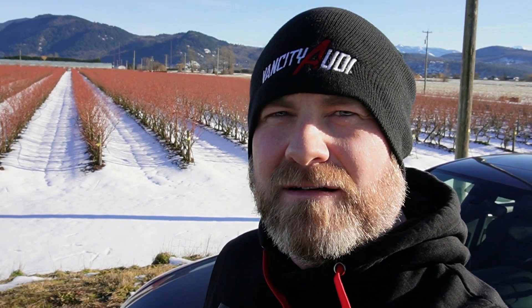Very interesting results. Now that you have all that data from your car, you may be wondering how to improve performance if you saw ignition correction. In terms of my vehicle, we saw peak timing of 15 degrees but a small amount of correction on all six cylinders from both VCDS and the IE Power Link system. What I've been doing for years is blending a small amount of ethanol into your pump gas to correct those corrections. In terms of the amount of ethanol, you do not want to surpass 20% in my opinion.